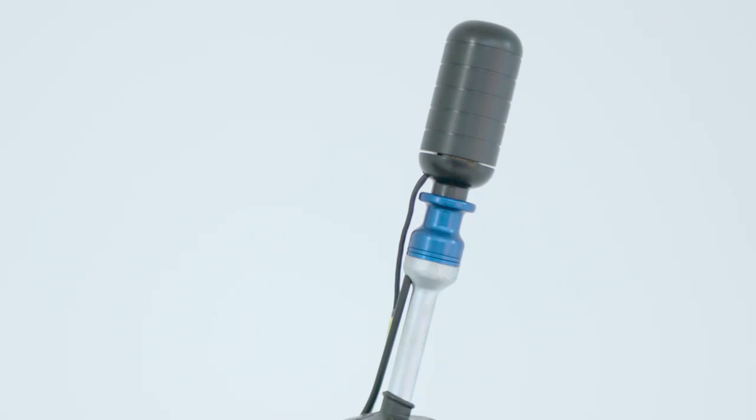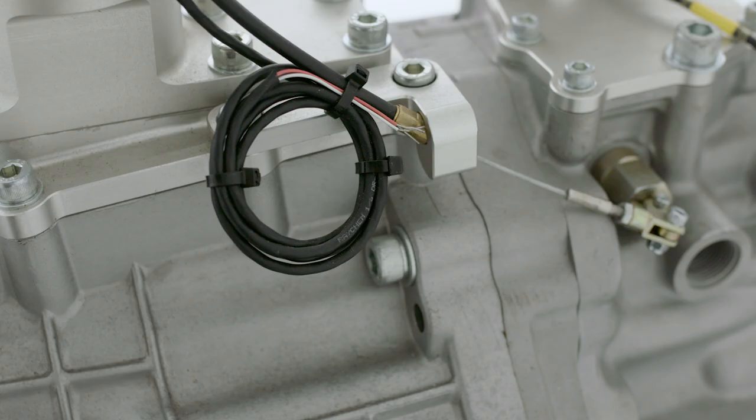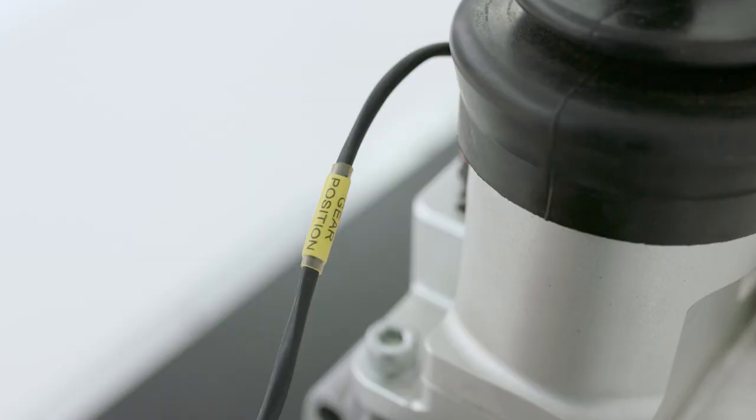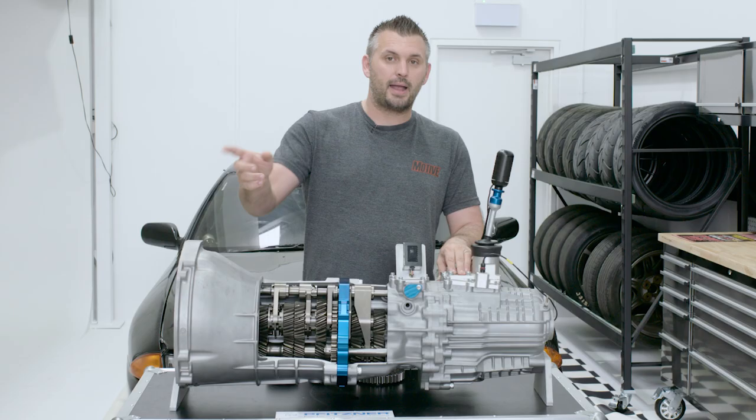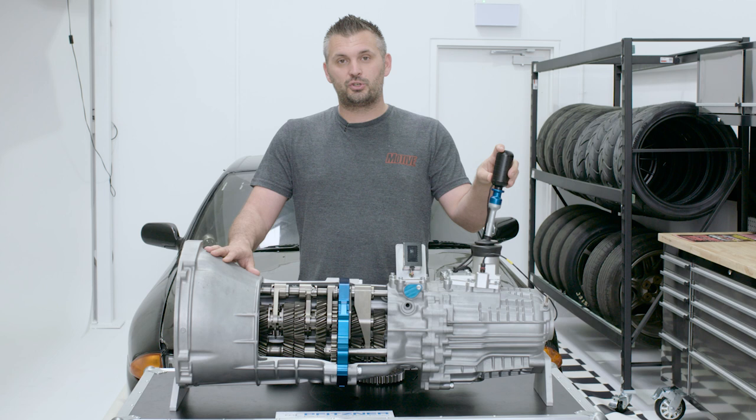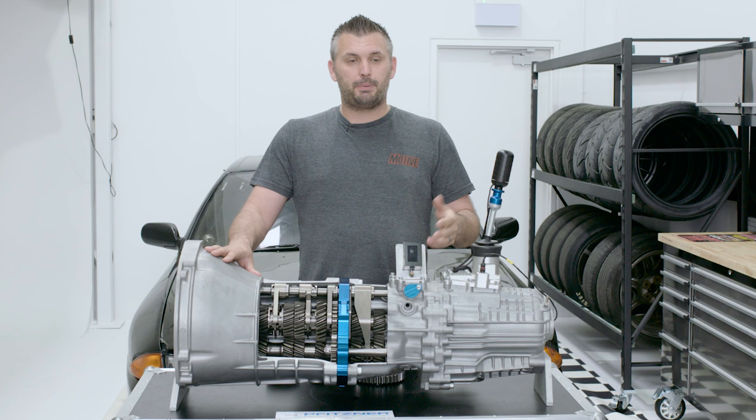This PPG has what's called a closed loop flat shift system, so when you pull on the lever, a certain amount of strain gets detected, which sends a signal to the ECU to cut ignition, which obviously cuts the power. Then there is a rotary position sensor inside the gearbox that determines when you're in the next gear, and sends a signal back to the ECU to give power back. These flat shift systems enable you to not have to lift the throttle on gear changes. However, if you have a sequential that isn't dog engagement, that won't work, so it's all part of a complete system.